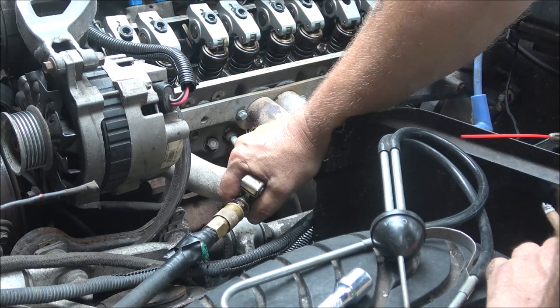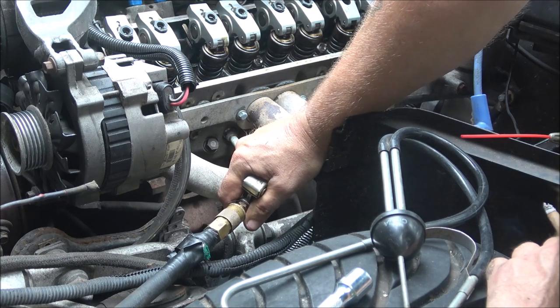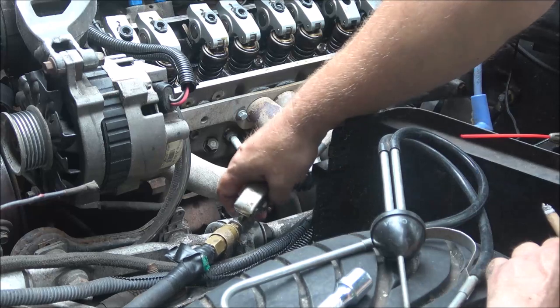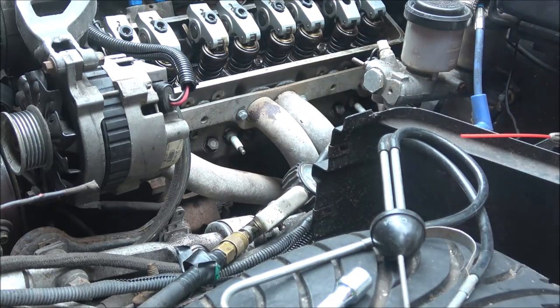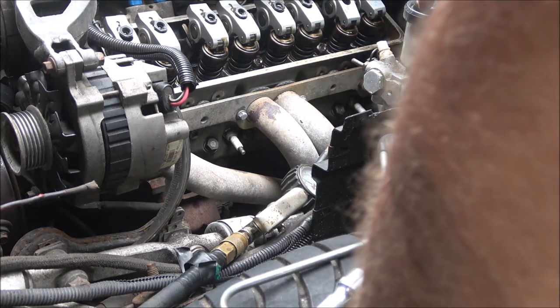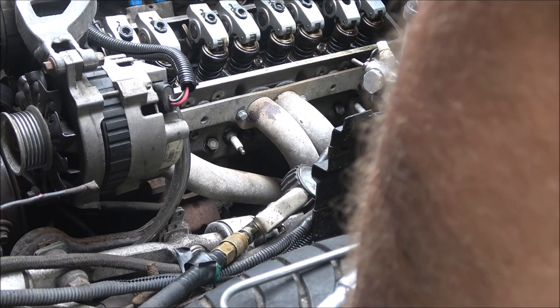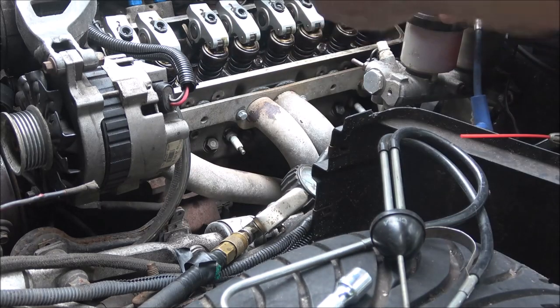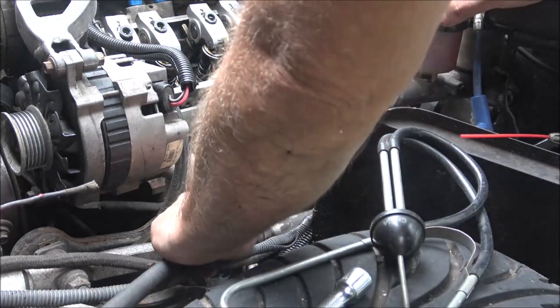There's 100 pounds. But when I listen, I can't hear it coming out the exhaust or the intake. So, well, at least we know it's not a camshaft. But at the same time, is it a leaky valve? If that thing's putting close to 200 PSI in it, that could be enough to bypass whatever crack or leak it may have, to where 90 to 100 pounds ain't doing it.